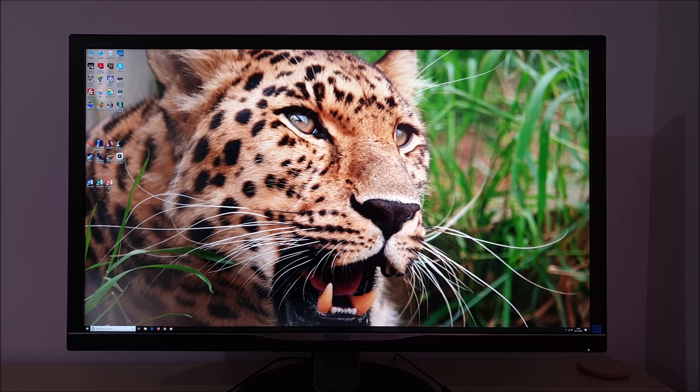The static contrast is a major strength of VA models such as this, and this model did indeed have very good static contrast. The screen surface I didn't find particularly agreeable — it was a bit grainy for my liking, though I've definitely seen worse and it's something I'm sensitive to that doesn't bother all users. As a VA panel it also had a bit of VA glow — nothing extreme. And it had a moderate amount of black crush, so there were some losses of detail in dark areas. In terms of colour performance, it has a generous colour gamut with really good coverage of the DCI-P3 colour space, so things are quite vibrant overall. There were some losses of saturation towards the edges and bottom of the screen — a bit higher than I've seen on some modern VA models of this size recently — but not extreme, and not compared to the vertical shifts you'll see on TN models.